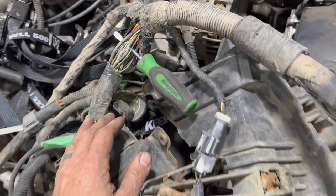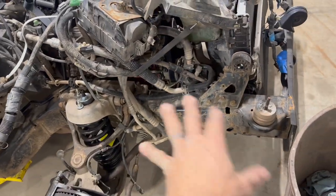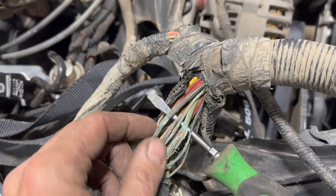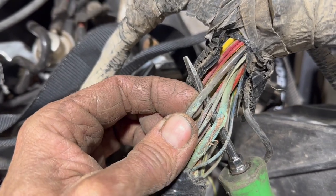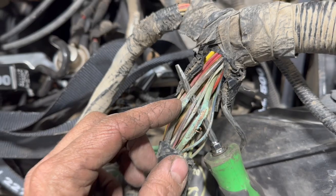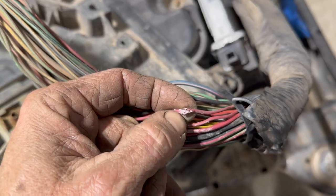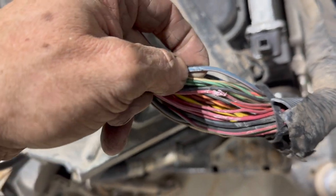Sometimes you find something you weren't expecting — that's exactly what happened here. I had taken the battery off and flipped a bunch of the wire harness up on top of the engine while doing exhaust work, and I just happened to spot a bunch of wires that had been rubbed through on the fender. I'm going to fix those — looks like five wires rubbed through with some corrosion entering. I'll cut them, strip them back, make sure we have good solid connections, crimp it down, heat shrink it. This appears to be damage from when the car had a front-end fender bender.